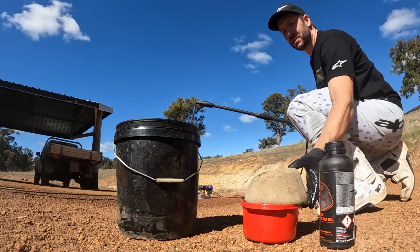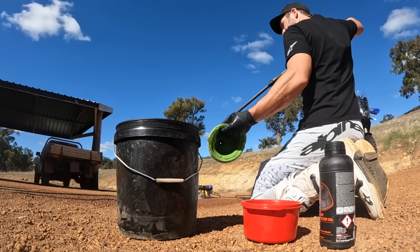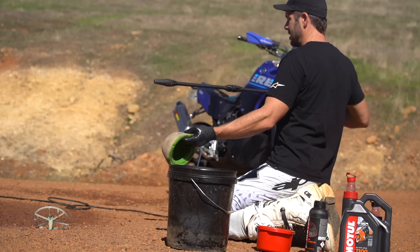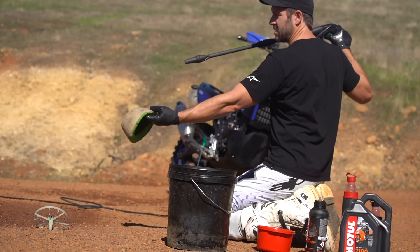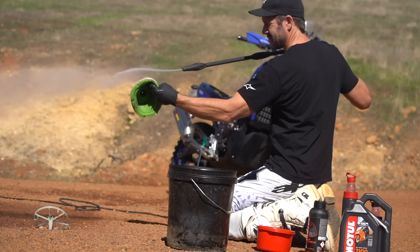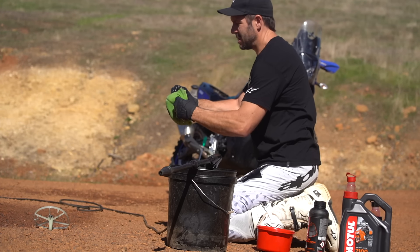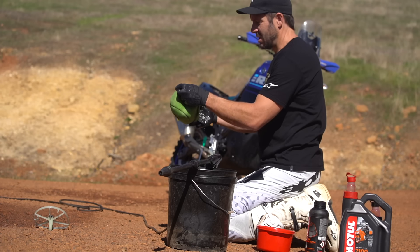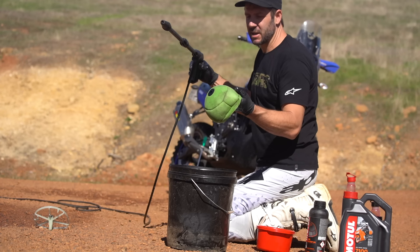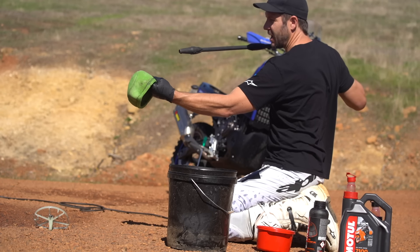Here's how to return a filter to like-new. Remember what I said about angling the jet so it acts like a vacuum and sucks the dirt away? Turn it inside out. Now that pressure washer could obliterate this filter at close range — notice I'm holding it right back and just skimming it. But if there's any dirt granule in there, it's getting sucked out.